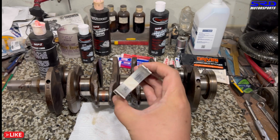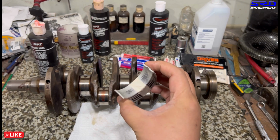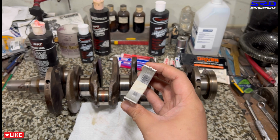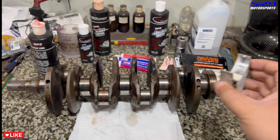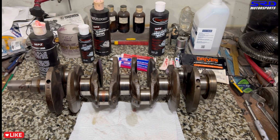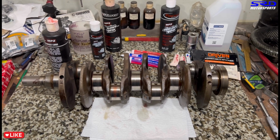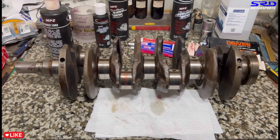Because look at this. This is the earlier B20 VTEC that we rebuilt. Look, aside from being built really dirty, that wear is probably from dry startup. And of course, it didn't help even if it was well lubed. If it was dirty, it looks like it had sand. So that's crazy. Look at that. Let's look at it closer. Let me clip the phone to show you guys.